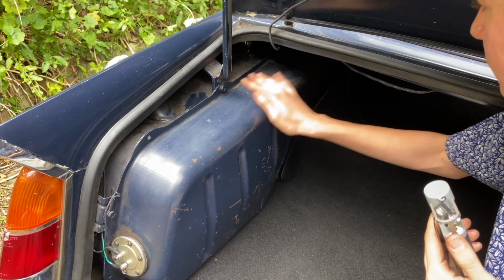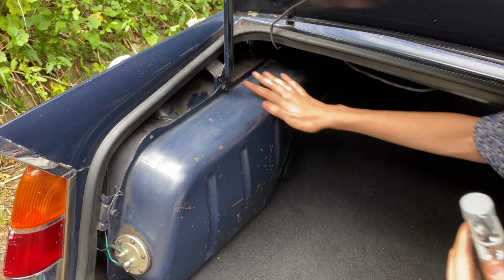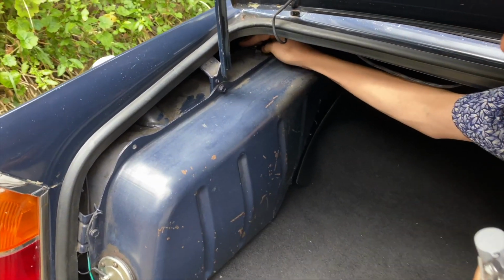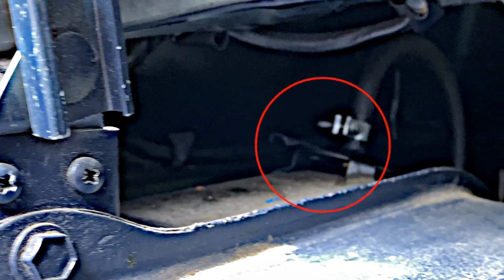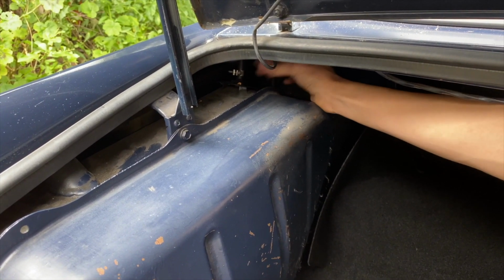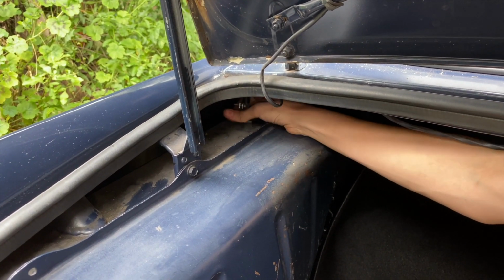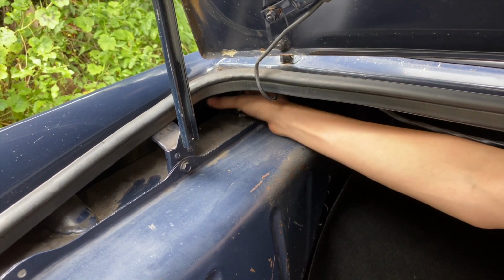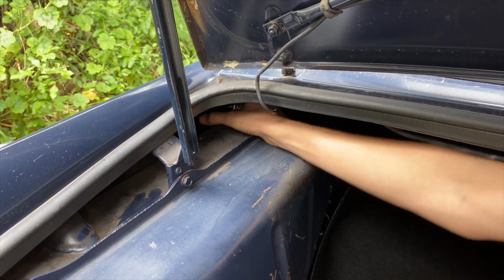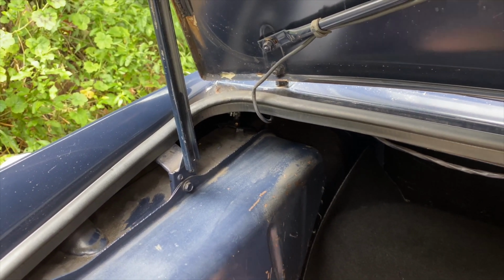So originally this car would have had a little decal here, which would have told the user in which position the little tap on top of the tank is, in the main position or the reserve position for the main or the reserve tank. To add a selling feature to the Herald in the 1960s, they decided to put the so-called reserve tank in, which isn't really a reserve tank. All it is a tap which moves the hose inside the tank so you can suck out a bit more